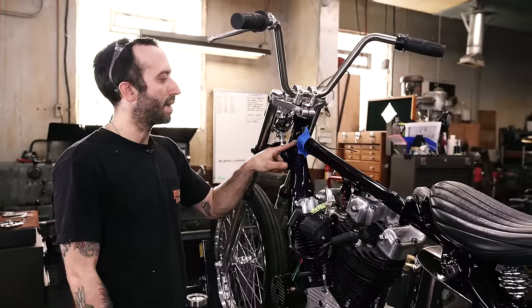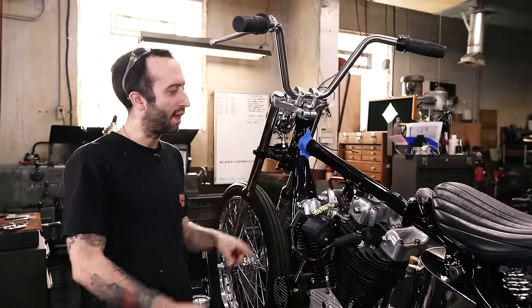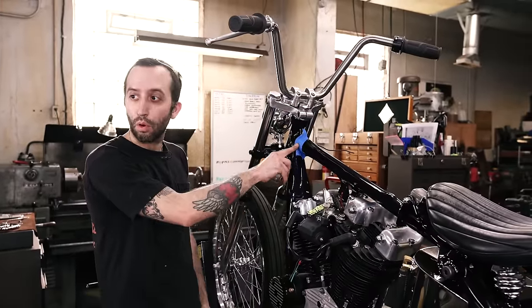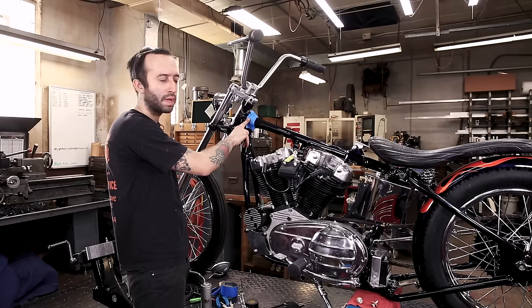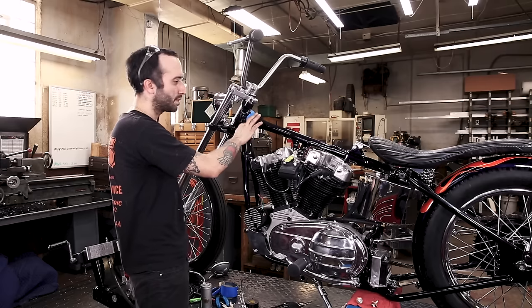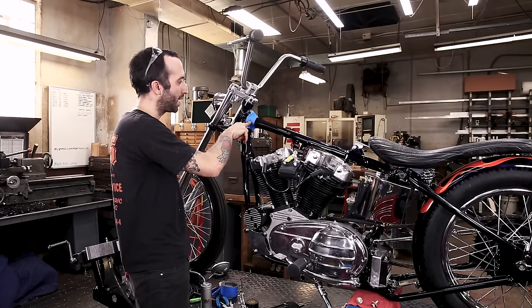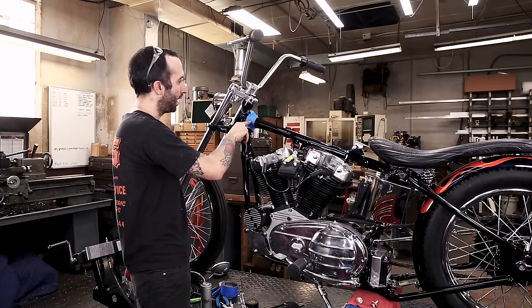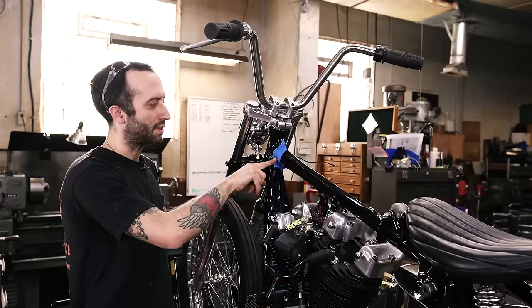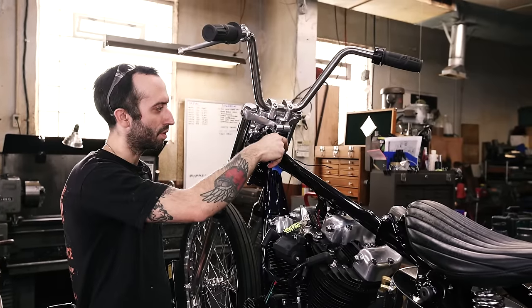I honestly should have maybe taken a little washer and welded that on over this hole before it was painted, so I had a nice surface to clean off, so it's a really easy place to put a ground to, but sometimes you overlook some things. But I think this is totally fine. It's just the ground for the headlight, and it'll also be grounded to the bucket, but I think this is gonna work just fine, just being drilled the way it is.